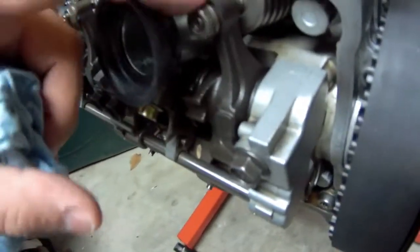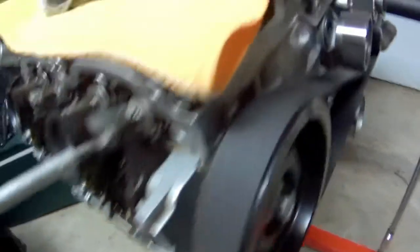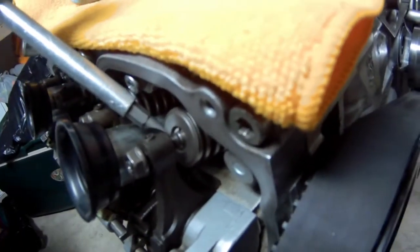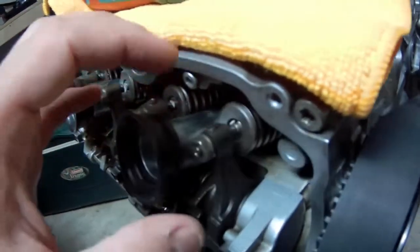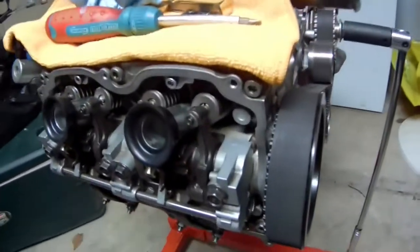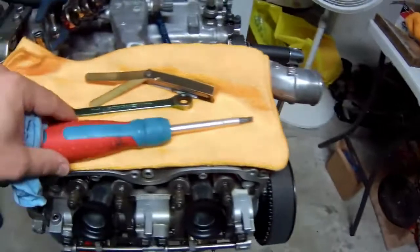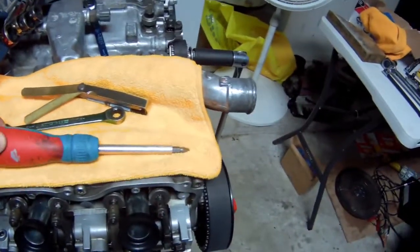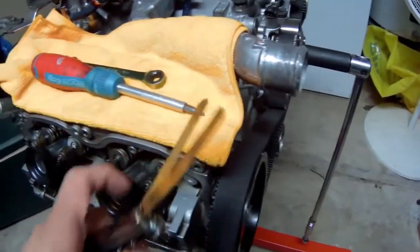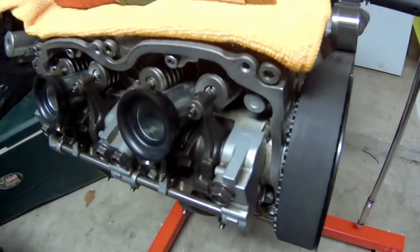You can see how this nut loosens up here, and there's a little screw hole right there too. This big screw here is what adjusts the valve clearance, and once we get it to where we want it, we're going to tighten that down. It's going to be a concerted effort — we're going to use a screwdriver and a 10 millimeter wrench in concert with one another. What we're going to need is a flat head screwdriver, a 10 millimeter wrench, and some feeler gauges.